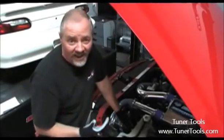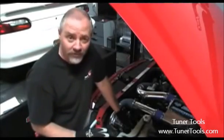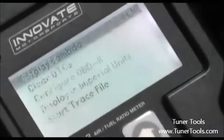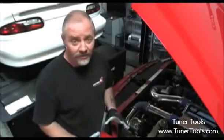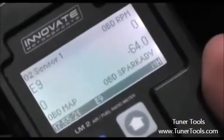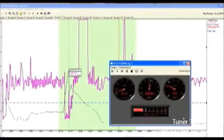As an ASE-certified mechanic, I know how important OBD2 onboard diagnostics are for troubleshooting. The LM2 gives us the ability to read up to 16 channels from the ECU and record it to an SD card. Not only can we troubleshoot with the LM2, but we can get valuable data from sensors like coolant temp, spark advance, and air inlet temp. You can then cross-reference this against the air-fuel ratio and RPM in the Log Works software.